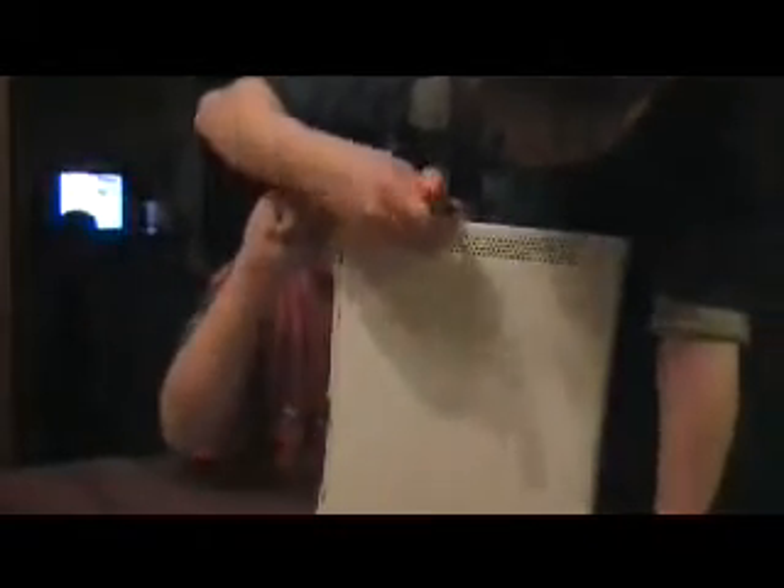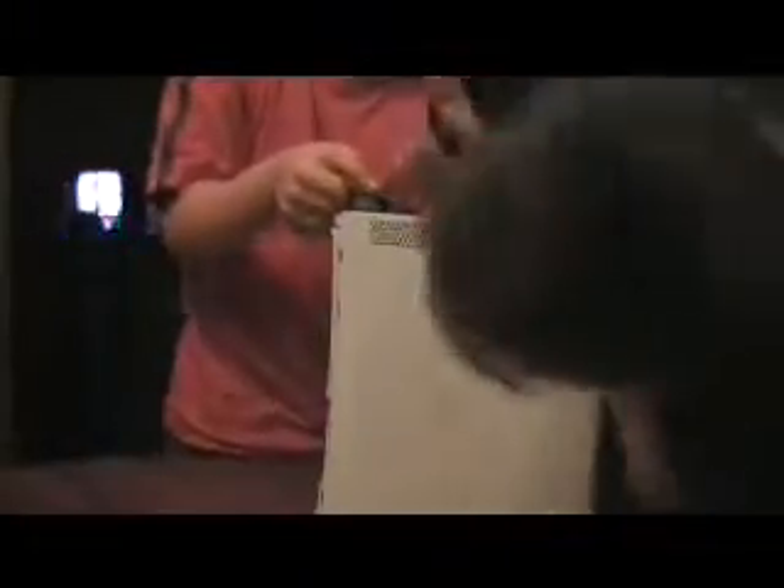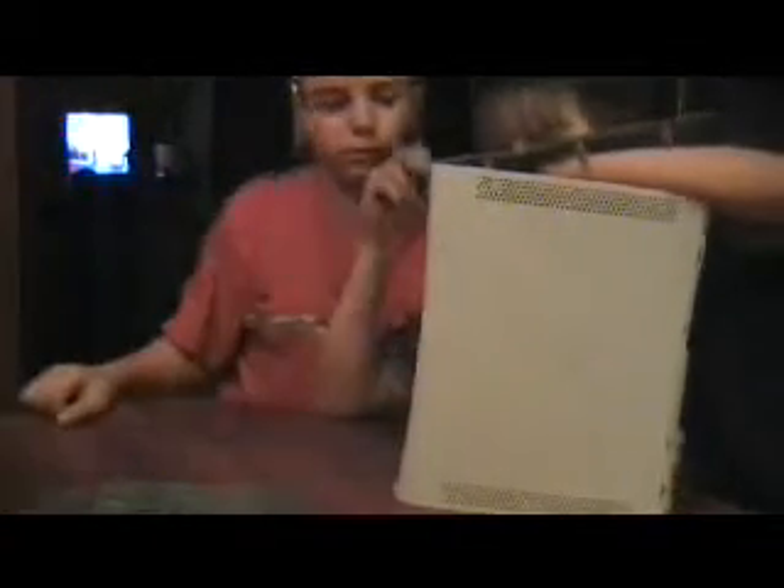As you can see, there are little holes. You want a little tiny tool that you can just come through here, and if you come in these little holes, some of them have pins in them, some of them don't. You can just pull it off. That one was actually easy because we've had this console apart before. The bottom one is the easiest one to pop — pretty much just pull the bottom. If you've got a new Xbox, it'll be harder to do because you have to pop the pins.